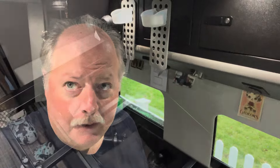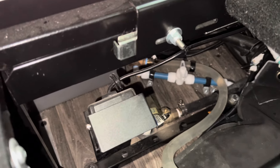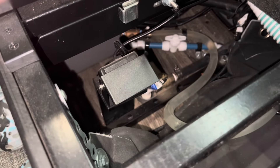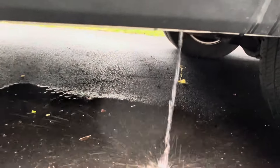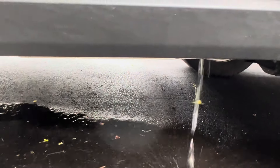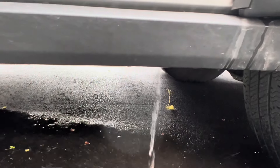The first step is to go ahead and dump the water in the fresh tank. In our Dauphin S model, to dump the fresh tank we need to get to that white valve. Yesterday we were dealing with the gray valve, which you can see still in the open position, but that white valve is the one to dump the fresh tank — it's currently closed. I'm going to open it now, allowing the fresh tank to dump. Outside the van you can see water dripping out the bottom, through a tube that leads from that valve down through the floor to the outside.